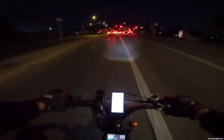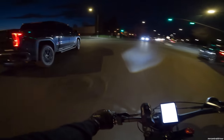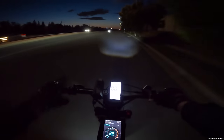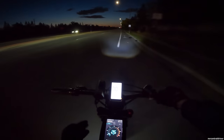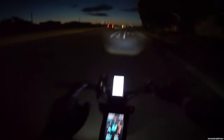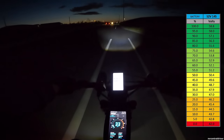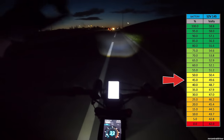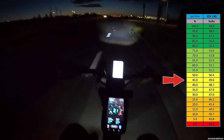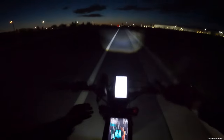We're dipping into the street real quick — we've got a fast e-bike, we can definitely keep up with traffic. We're doing about 33 mph, could go faster, but the battery is going down. This is a 20 amp-hour, 52-volt battery. Under throttle I'm pushing about 49.6 volts and when I let off it jumps back up almost 3.5 volts — that's quite a sag difference.